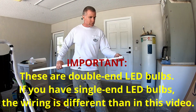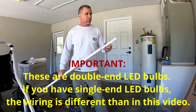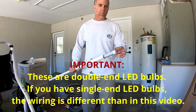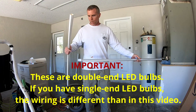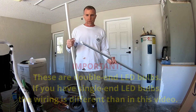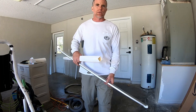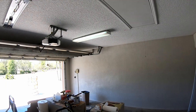These are the LED bulbs we're going to use. I'll put a link down in the description. These are actually pretty bright — they're double-sided. With the double-sided bulbs, we're going to put power to one side and common to the other side. With single-sided bulbs, you would run your common and power to one side of the bulb and the other side would just be blank. We'll go over wiring these up in just a second.